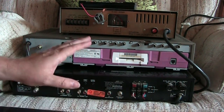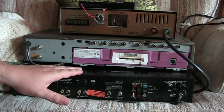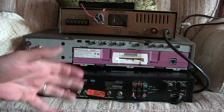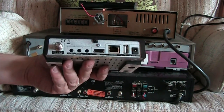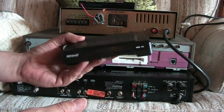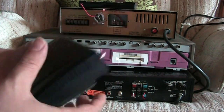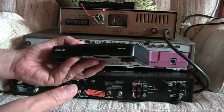These were expensive - probably over $500, and sometimes receivers were like $1,000 depending on how early you got into satellite. Where something like a modern receiver, you can get on sale for maybe $100 to $150 - an HD free-to-air receiver that will get C-band and KU-band. I don't believe this old one does KU-band; I think it's strictly a C-band receiver. There were receivers that did both C-band and KU-band, and there were even analog receivers that also did digital.